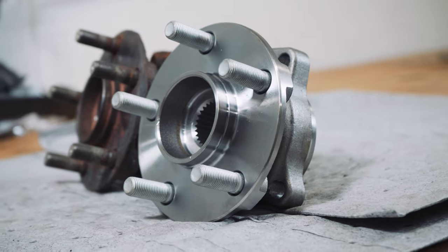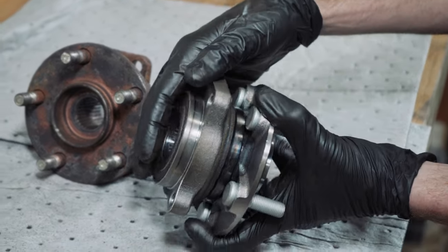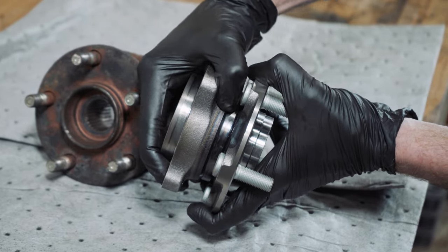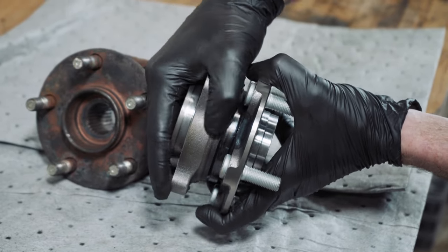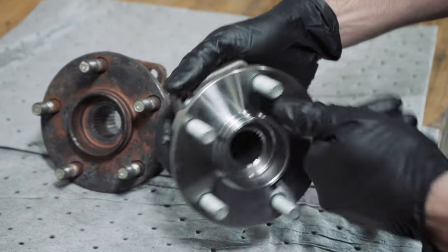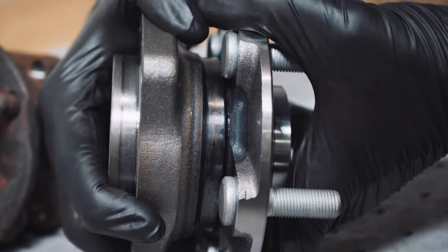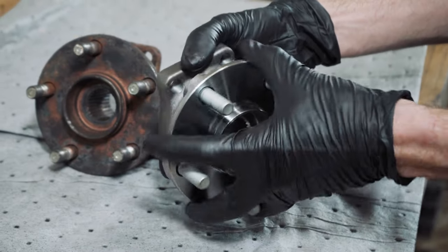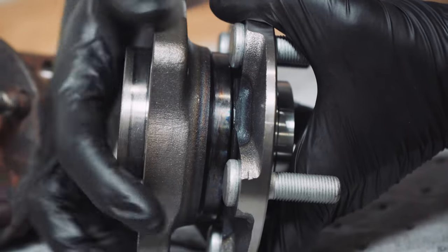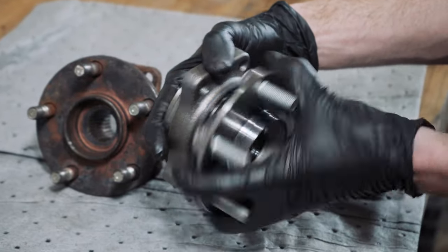Let's have a close look at the brand new bearing. The first thing you'll notice is it looks as though it's the exact same thing. We'll give this a wiggle — there's zero movement coming from inside this area. Try to give it a little spin. As you can tell, there is some resistance in this area. This doesn't necessarily feel like it's binding in any way, but it definitely does have a little bit more resistance — it's kind of harder to spin. There's also grease, which is lubricating the area. This bearing feels a lot better — I don't hear any noise coming from it.